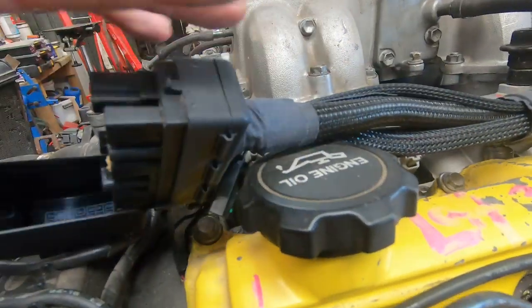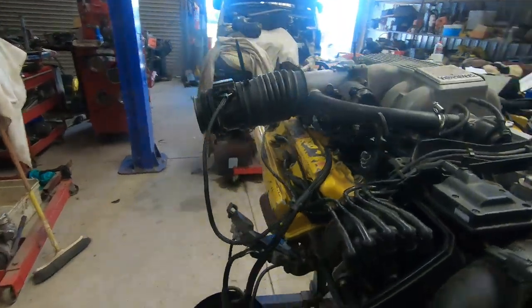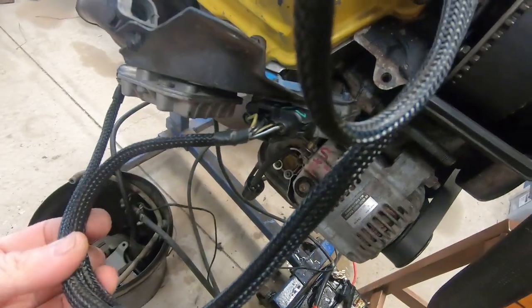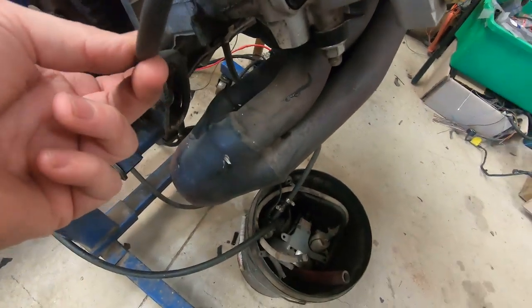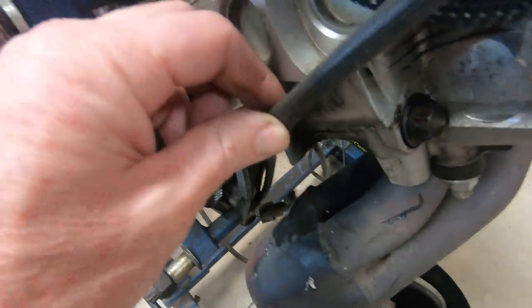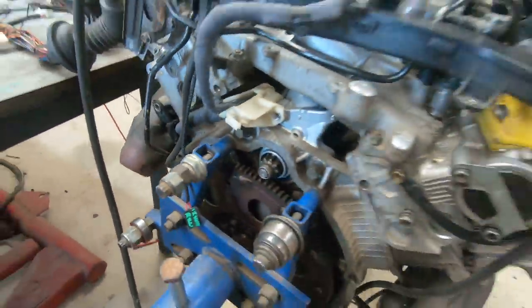We've got braided bits on it. The diagnostic box has been modified so it can talk to a scan tool. This is all braided up, out to the igniters, to the airflow meter, all braided up. New connectors on it. This one I've changed where the oxygen sensors go. They come down the back and it's got heatproof stuff on it. So hot, I don't mind it sitting on the exhaust even. It'll handle it, though mounted in place, we don't want it like that.